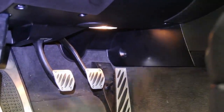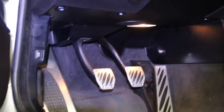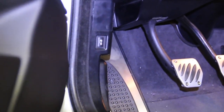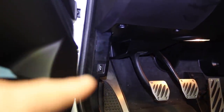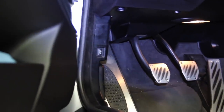You also need to remove the door entry guard, which is held in with four clips — just grab under it and pull straight up. Then there's the panel by the trunk release button and hood latch. The hood latch is held on with one Phillips head screw. Carefully pry off that panel, watching the wiring on the trunk release button. There are also black Phillips screws holding the OBD2 electrical connector bracket, with the carpeting sandwiched between the chassis and bracket.